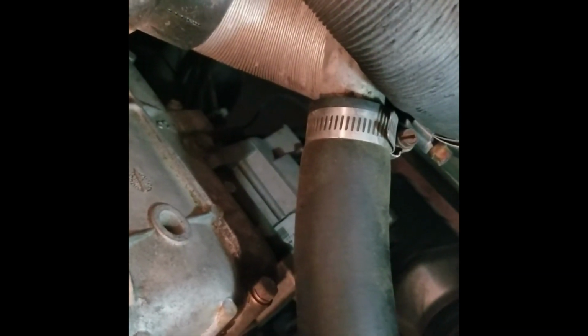The other upgrade that I did was the alternator is a Saturn alternator that you'll read about on the forums, because my original alternator was actually one that I believe somebody had rebuilt and changed over to basically a one-wire alternator, which, if you're not familiar with that term, the alternator actually does not switch on until it reaches a certain RPM.